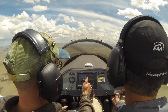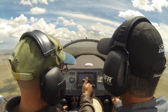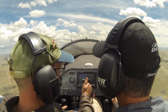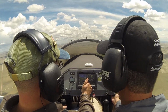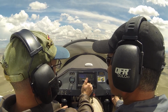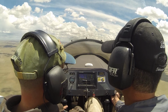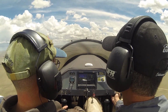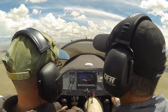Just bring it back to cruise power. Cruise is anywhere from 2700 to 2900 typically, 3000 even. I typically like to set it up for about 2750, and then I lean it to 6.5 to 6 gallons per hour. And that usually gets me about 150 true. So like, we're sneaking up on it. We're right around 150 right now. Still climbing a little bit.